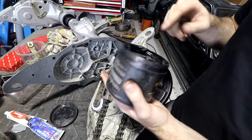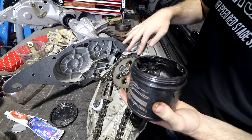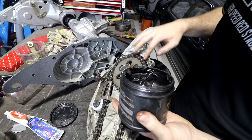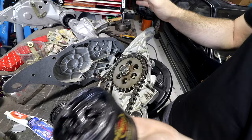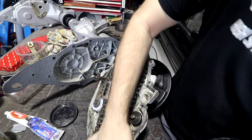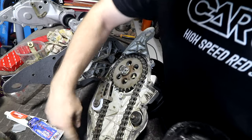And because they're lots of little discs, if you imagined a grease that had small balls in it instead, like a bucket full of ping pong balls or golf balls, you could shove your hand through it and they'd all sort of push out of the way. But if you imagine a bucket full of coins, you can't push your hand down through the coins because they all sort of sit on top of each other.